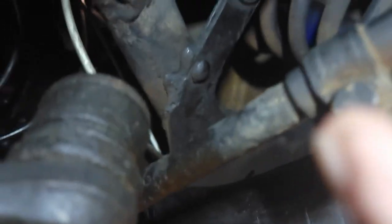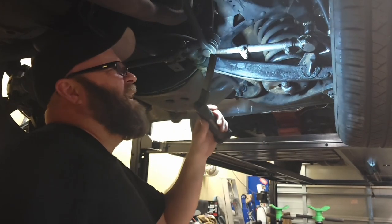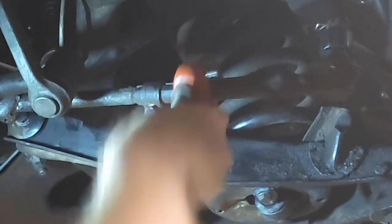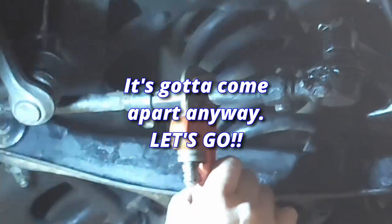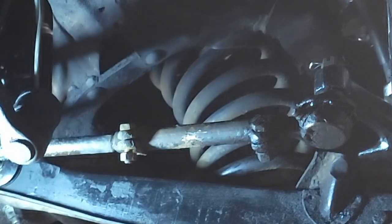As you can see there's no threads left on that end or that end, so I'm assuming this is already bottomed out. I'm gonna try to turn this and see what I can see — I'm gonna have to take it off completely. We all know how easily the knees all came off. I got the right tool now though, not a lot of room. I might just have to deal with it in the morning. Let me see if I can get this tie rod end off the wheel side first and we'll go from there.